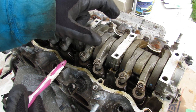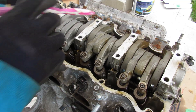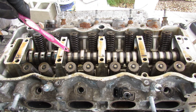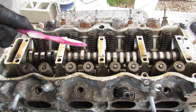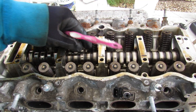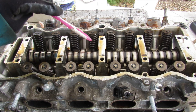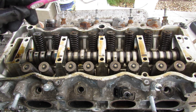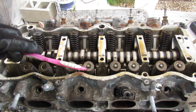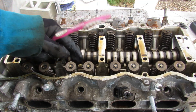This engine does have VTEC, and that's why you have this extra cam in between here, which is going to lock these rocker arms to a certain profile in the middle of the camshaft. Taking a look at the camshaft down the middle, you can see there are five lobes for each set of cylinders — four valves plus the fifth one for VTEC, which has a slightly higher profile. Those are going to lock together to feed more air to the valves during the intake stroke. This is more of an economy version of VTEC where you have two lobes for the intake at normal profiles up until about 3,500 RPM. Then when VTEC kicks in, that pin in the rocker arm locks these two cam-profile rocker arms to this higher profile — which is not that much higher, but it does have a longer duration to give you more power.